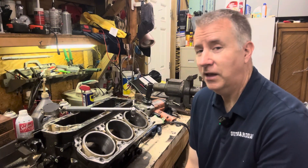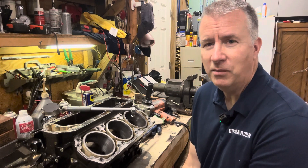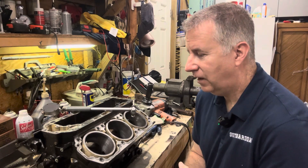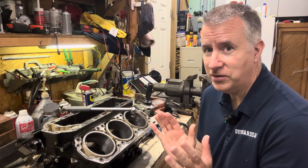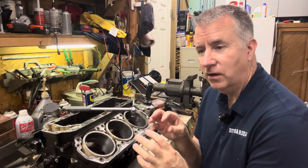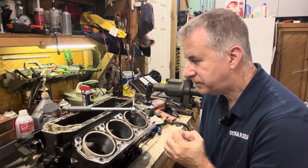Normally I probably wouldn't do all six - it's a lot of work. Used to get a hundred bucks a hole at a machine shop; I'm sure nowadays it's more. There were times I'd send it to a machine shop just for time because I was building so many motors. But I want to show you guys how to do this. I'm getting ready to buy a kit because it's probably cheaper, and they'll let you swap in a 20 or 30 thousandths-over piston for one or two cylinders if needed - a lot of people don't realize you can do that with two-stroke outboards.